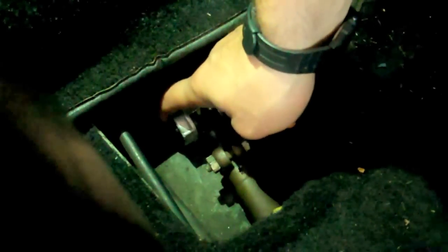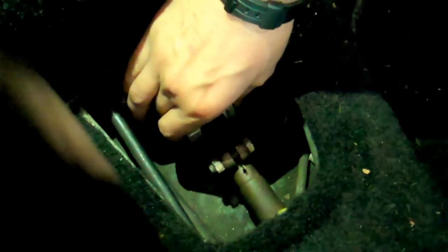For this particular car the tools are 13 and 12 millimeters, and you're going to loosen that and get it nice and loose. You can tighten it and it's not a big deal. So now it's nice and loose — it slides. There's a little bit of forward and back movement on this car; the way to do it is you find the middle. So you move it forward, move it back a little bit.